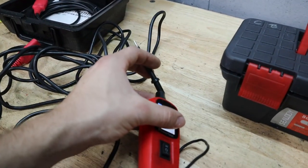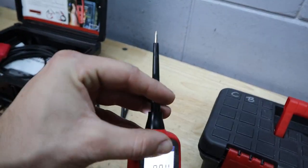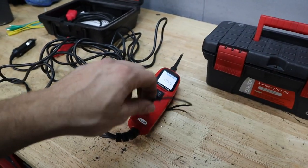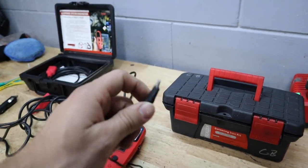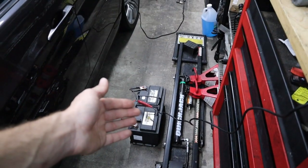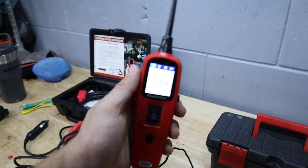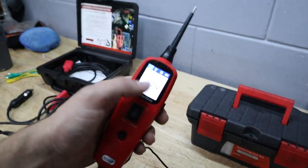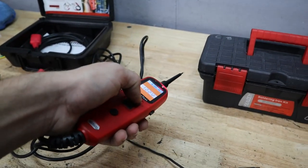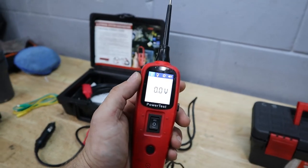It comes with this needle — I guess that's why they call it the power probe — and that's what allows you to apply power to a lot of different circuits. There's also this little dangling alligator clip which is a constant ground from whatever battery source you're connected to. A lot of times when you connect this to the car you don't need to use the alligator clip because everything inside the car is hopefully already grounded and you would just apply power to whatever you wanted to test.